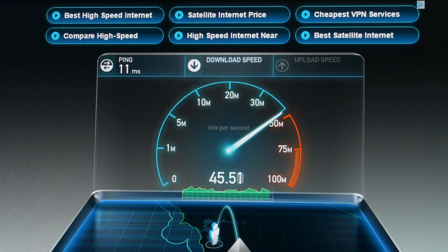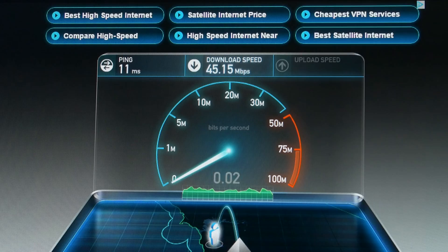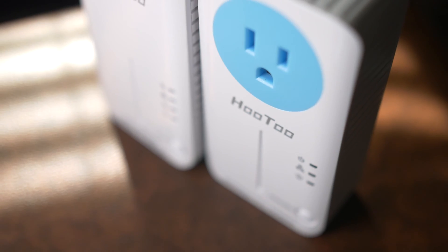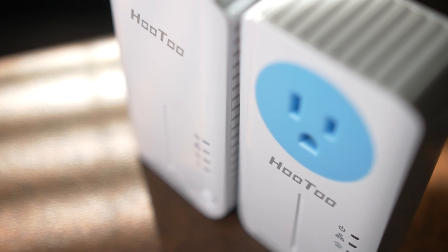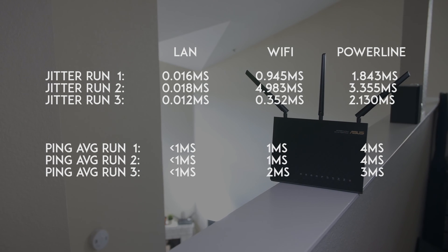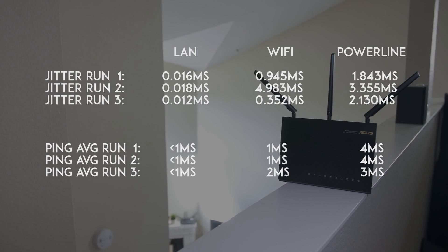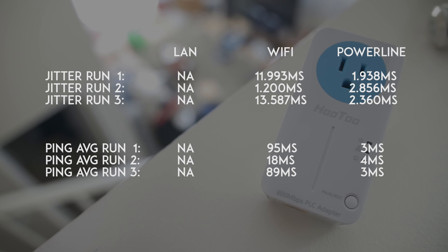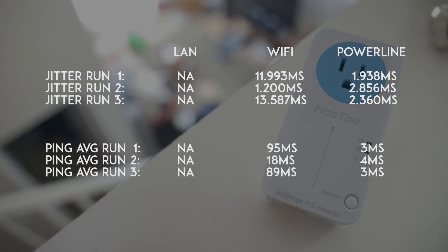That's significantly slower than what my ASUS router was able to achieve on 2.4 and 5 gigahertz a couple rooms over. While not suited for internal network file transfers, it's perfectly capable for surfing websites and streaming services. Since bandwidth throughput is only one piece of the puzzle, I also ran a quick iPerf test using UDP to measure jitter — which is latency variance — and ping to measure latency itself. LAN scored the best with the lowest jitter and lowest ping, while Wi-Fi came in second with the power line last. For fun, I moved my wireless access point as far as I could to the other side of the apartment — about three rooms, a kitchen, and a living room away — with my client and power line on the opposite end. After rerunning the test, power line came in second with nearly identical numbers as the first run, and Wi-Fi came in last with very inconsistent results.